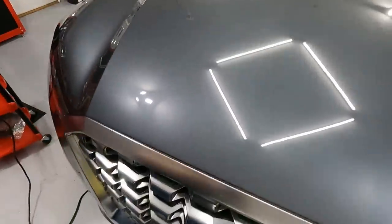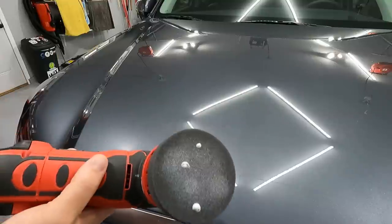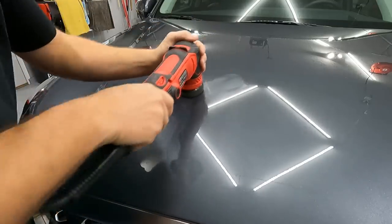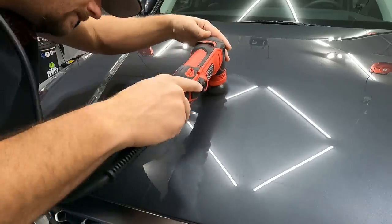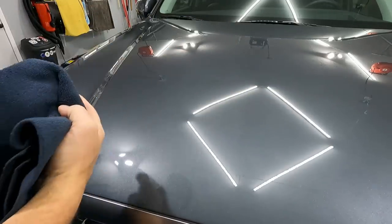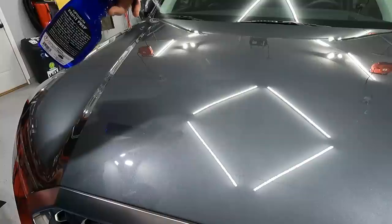There's one I did not go up that high. But those marks that were there, they're gone now. I am really happy with that. These are not crazy deep scratches by any means, but we need to make sure this paint's perfect for it to put the coating on. Now that I've already primed it, we're just going to put a couple of really small dots because I'm doing spot correcting. I'm not doing huge spots on the car, like a whole hood or a whole door.